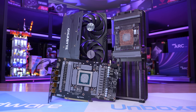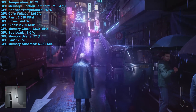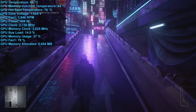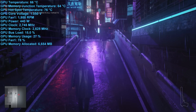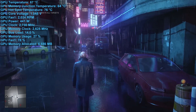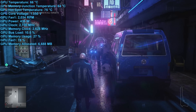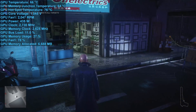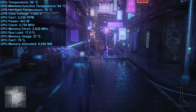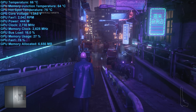So let's go over some stress test results. Here's a look at how the Gaming OC operates after an hour of Hitman 3 at 4K using the maximum in-game quality settings, recorded in a 21-degree room installed inside an ATX case with the doors closed. The GPU hotspot hit just 76 degrees, though the fan speed was reasonably high at 2000 RPM, generating 44 decibels of noise. The average GPU temperature peaked at 67 degrees and the memory at just 64 degrees, which is very low for GDDR6X memory. For reference, the memory on the NVIDIA Founders Edition ran 18 degrees hotter under the exact same test conditions, while the GPU hotspot was 7 degrees hotter.